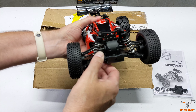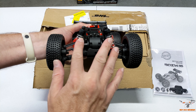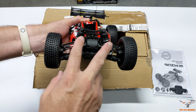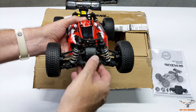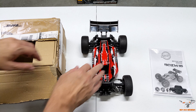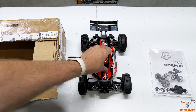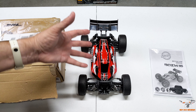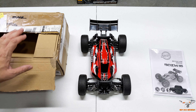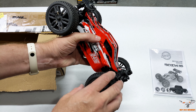The shocks are just friction shocks, but they feel pretty nice. They look sort of like oil-filled, but on the Banggood product listing they show an exploded view of the shocks, and I don't think these would hold oil — they'd probably leak. They're pretty decent though; there's a little drop, not too bad. Friction shocks are usually really bouncy because there's no oil to dampen them, and these are, but I've seen way worse. On this size car these will probably be okay. An oil-filled set would always be an upgrade and wouldn't be very expensive. I know this has full ball bearings and a metal differential.